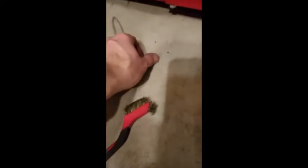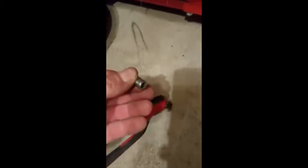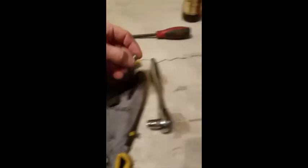Make sure you keep the bike in an upright position so both the oil and the transmission fluid can drain properly. Once you pull the drain plug, take a wire brush and clean the threads as well as the magnetic area. You'll find some metal shavings on there from when it was inserted into the transmission, and stuff that comes out of the transmission fluid will tend to magnetically stick to it. Clean it up with a wire brush, then wipe off the threads with a clean rag to get all those metal shavings off.